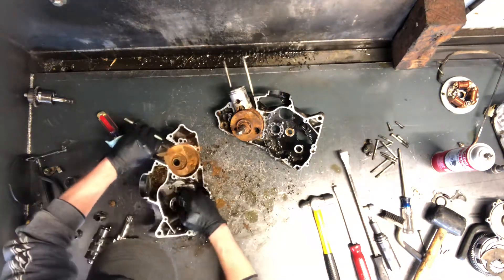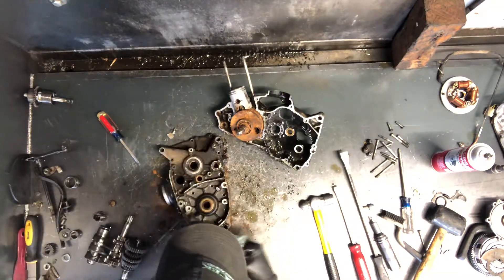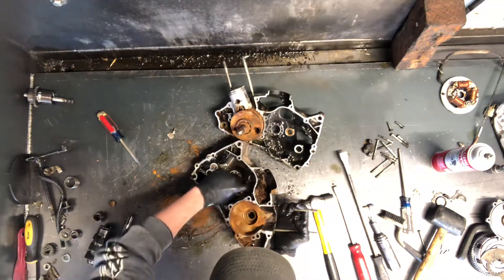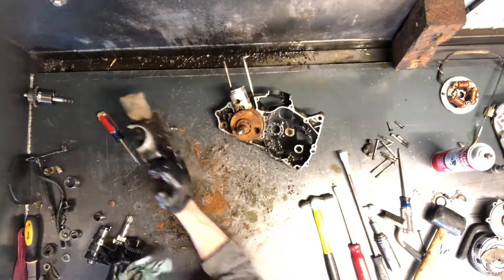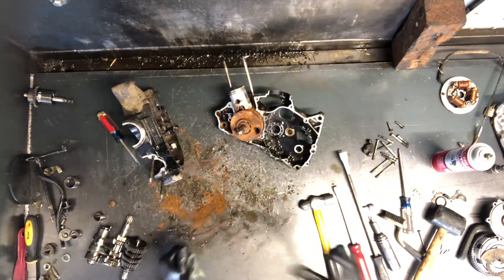This is the piece that I broke off here, and it looks like this little piece comes out. I'll take and press this out here. That looks like a replaceable piece — it's a brass insert that kind of holds that gear straight. So that is the crankcase split on a KE100.